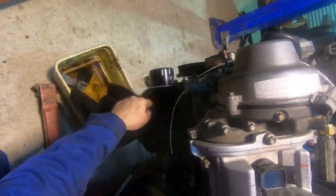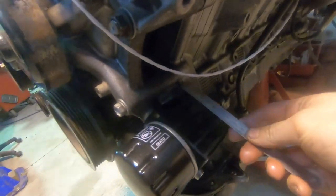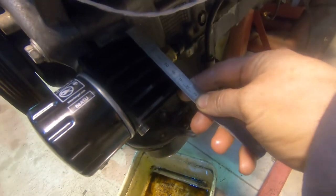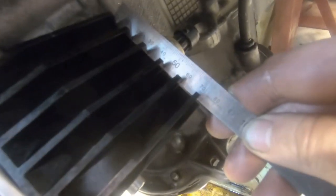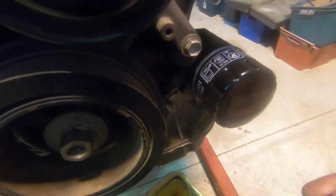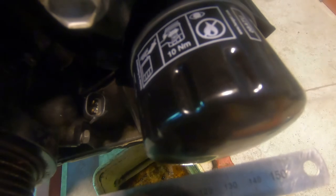Wipe the excess sealant off, and there we go — filter housing swapped. The overall extension is just over 70 millimetres — like 72 millimetres — and it comes forward with the short oil filter. It sits behind the crankshaft. So that's one really simple solution I have for oil filters and oil filter housings. Nice and neat and tidy, and I use a lot of them. I hope that's helpful and we'll talk to you again soon.